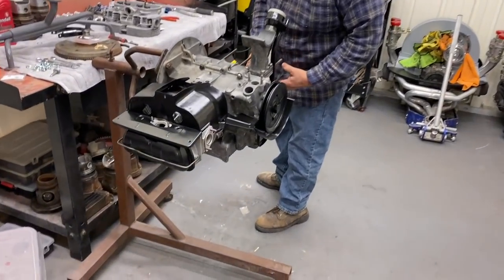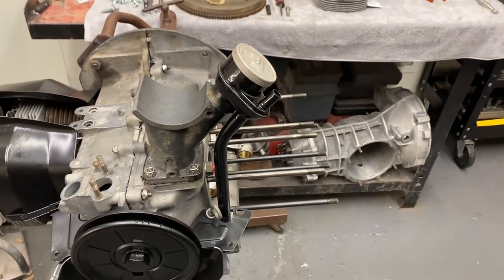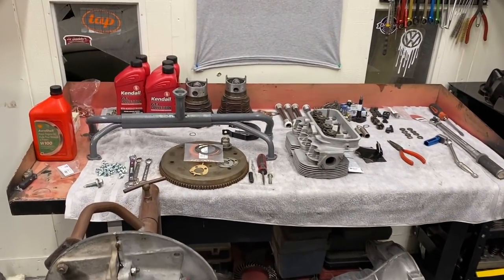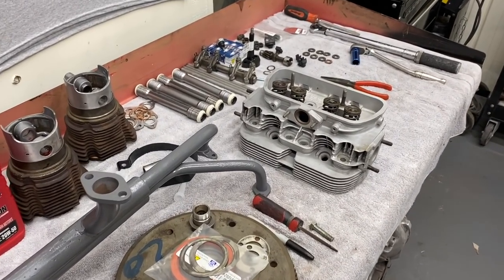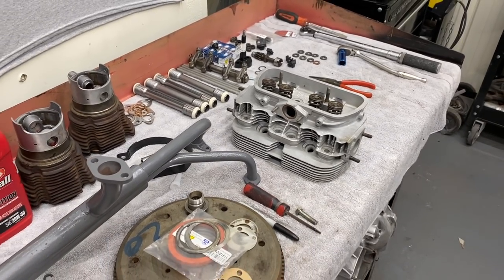CT's gonna build this side. All right, so what are we getting into here, Darrin? You're gonna be putting the piston cylinders on first. We're gonna put some sealer on those and we'll install that. And then have our push rod tubes, our deflector plate. Basically, you're gonna bolt this side of the motor up and then we'll work together on putting the sheet metal and the drive gear and the rest of the components on to make it run.